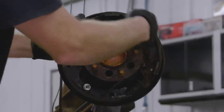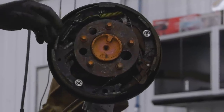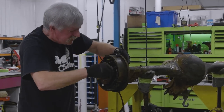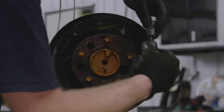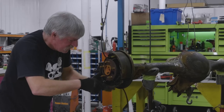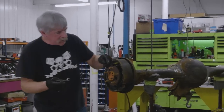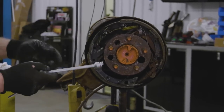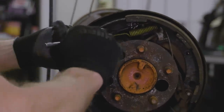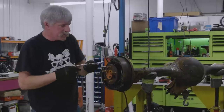Here's our brakes. I'm going to go ahead and get the brakes loose — got a spring tool here that makes removing the upper springs a lot easier. Put it in there, hook it under the spring, twist it in a half circle, and it pulls the springs off.